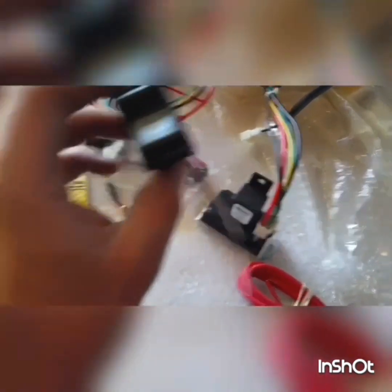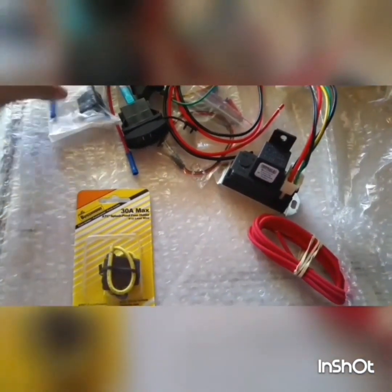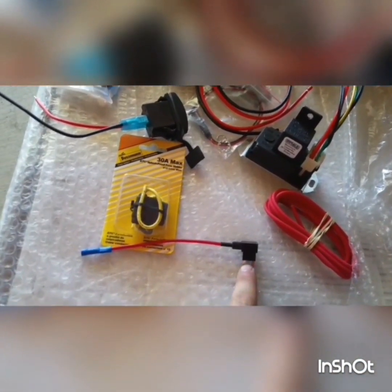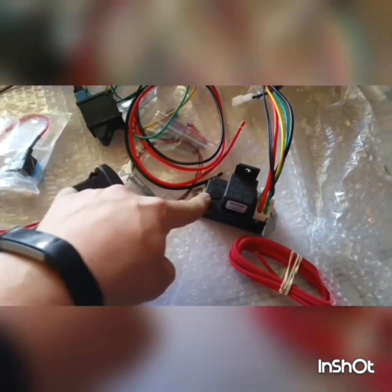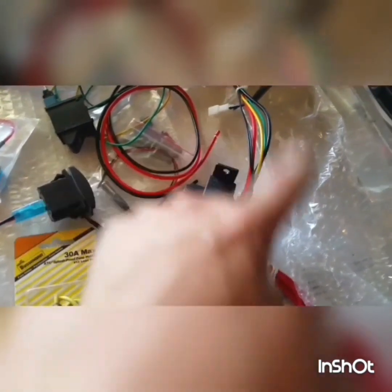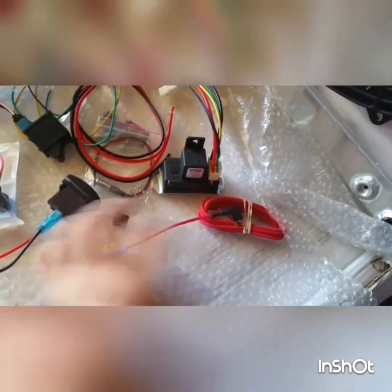This was real nice because it's just plug and play, with three wires and an LED. To step back a little bit on the controller: there's another fuse tap, so in the wiring diagram you use a positive 12-volt to turn on the relay, and then once the temperature gets to your set point, it will kick on the power side — the heavy current — to start up the fan. That fuse tap goes into the instrument panel or the fuse panel behind the glove box.